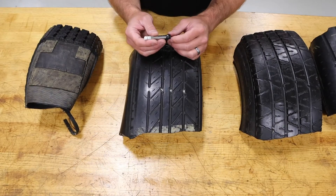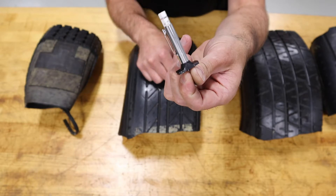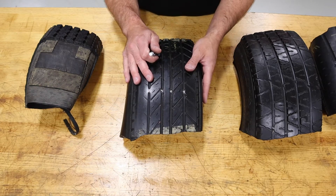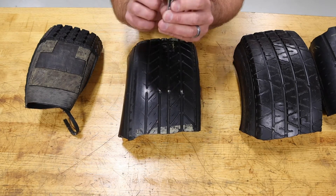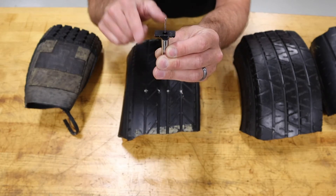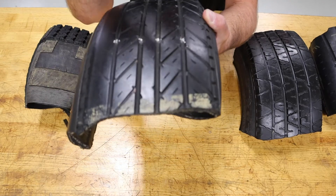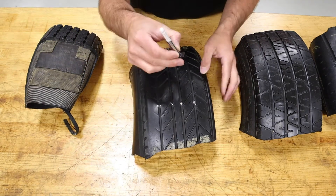To be more detailed and keep track of where we're at in our tire wear process, we do want to measure them. This tire tread depth gauge is a standard tool that we'd use a lot during routine maintenance — oil changes and inspections — to keep an eye on tires, see how they're wearing, and see whether or not we need to do a rotation. To use this tool: this flat portion is going to go against the tread, and the measurement probe goes down in between the treads in one of these kerfs. Put it to the tread like that, make sure I've got the probe sticking out, push it down until it's flat, then remove it and take a reading.